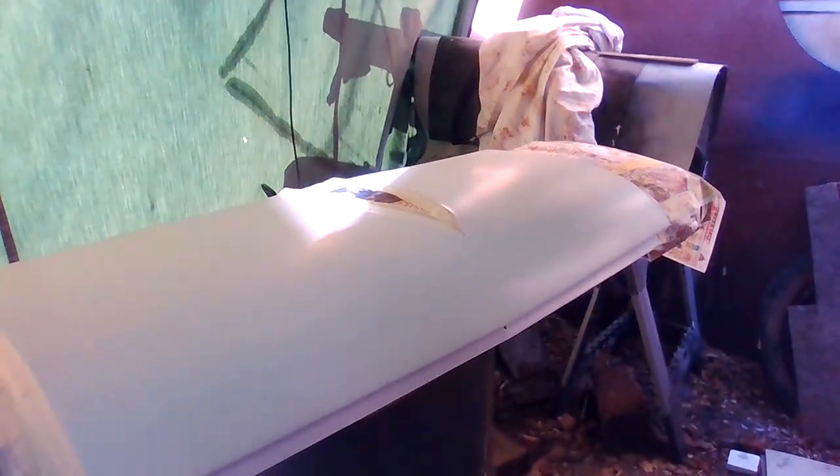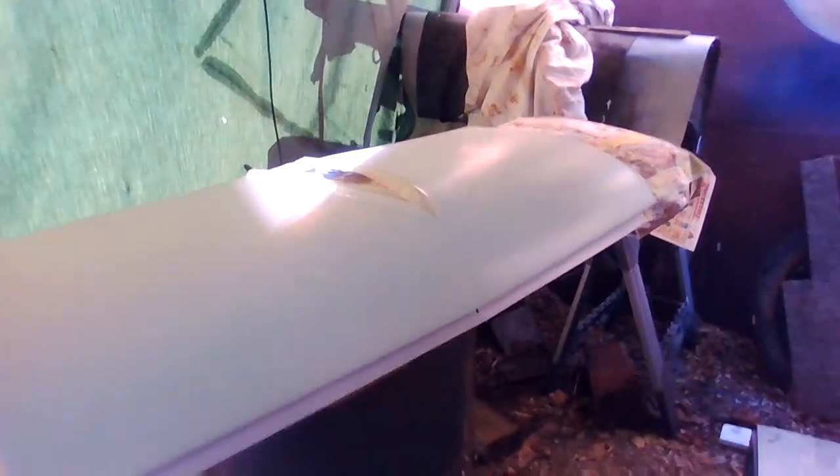I'm going to be painting outside. I've got this all masked off. I've got to bring out a couple more lights so I can light it up out here. I just have my little drop lights now. The wind is low, so I'll be okay spraying out here. I'm going to put the hardener in there, which will kick it off a little quicker. I masked it. First I went over it with 1500 grit, wiped her down, and then I masked off the rest right up to the lines where I want it. Covered it over. So that's pretty much ready to put the paint on now.